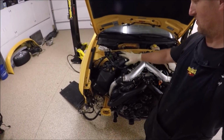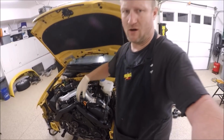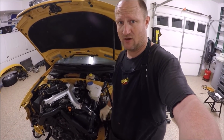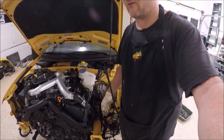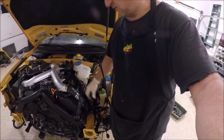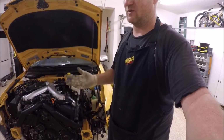At this point, airbox, everything's on. White pipe, reservoir. Gonna have to work on the wiring a little bit. On 2000 through 2001, the wiring loom is different than a 2001.5 to 2002. Depending on what you have, the 2001.5 to 2002 have a plate that goes right here, and there's only four connections, I believe, for the wiring loom, versus the older cars have a bunch more wiring connectors than the newer versions.